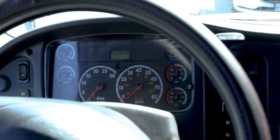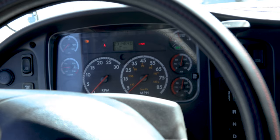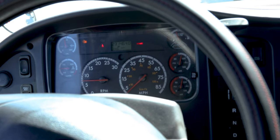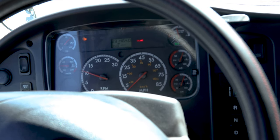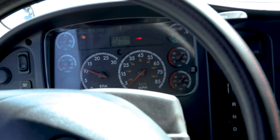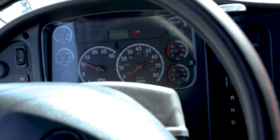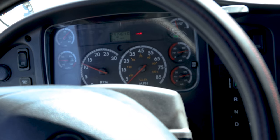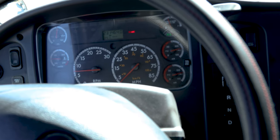I'm going to be performing the air brake test as if I was performing it for the examiner. If you want more detailed information, you can go to our other video. I'll begin with my cutout test. I'm going to accelerate to no more than a thousand RPMs to help the needle rise. My needle stopped rising at 123 PSI. This is a good test.